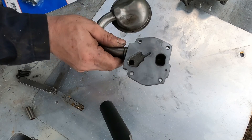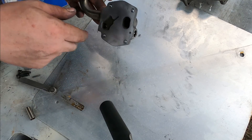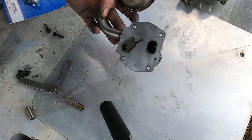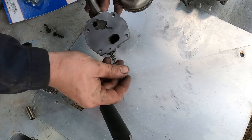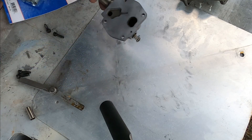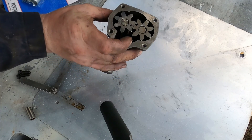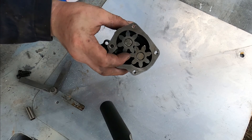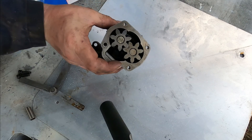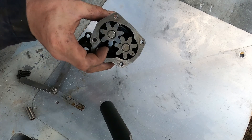To finish this pump — which I'll do off camera — wash it up really well, especially after any sanding. You don't want any grit left behind. I'll spend about 20 minutes hosing and blowing it off, then reassemble: put the spring in, hold it with a screwdriver, reinsert the pin. Then throw a little bit of white grease in the pump before you put it on — it'll help it pick up oil for the first time way better. Hopefully this helps. If I missed anything, chuck it in the comments and I'll try to get back to you. If you like this kind of video, press like and subscribe — we'll talk to you soon.